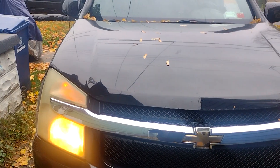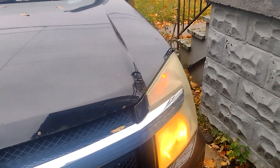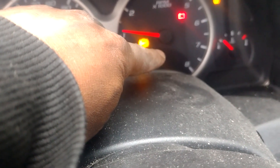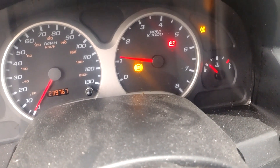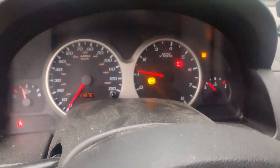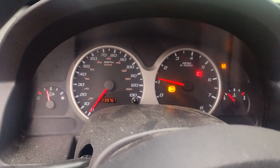Let's see if we start up. As you can see, the car is running. It took me a while to get it started — unfortunately we had a security key fault. So I had to turn the key to the on position, and there was a light under here — half car, half lock. Had to let it sit for 10 minutes, turn the key off, and then the car started up. This ain't our first rodeo with these security codes. Got to let this thing charge up, but other than that it starts right up. 06 Chevy Equinox alternator replacement.